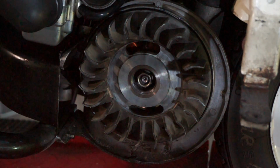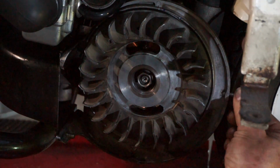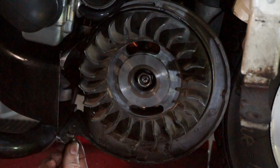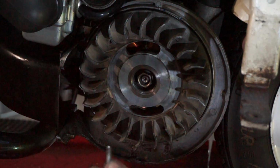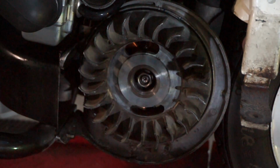Right, that's the flywheel back on, but I'm just going to have a look around here. This is a 6mm nut. Okay, it falls in there. That's it. Let's go down here. It falls in that one, so that's it. So that one's still got thread, 6mm. So we can see it's not only been tapped at 6mm, but they've already stripped the 6mm threads on it. So this is either going to be welded up or a new mag housing, and I'd go for a new mag housing, to be honest. Get a uni mag, and that'll do.